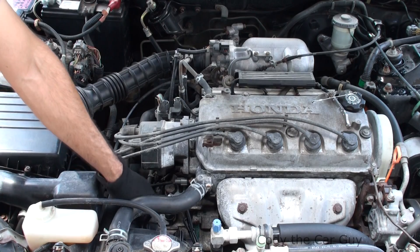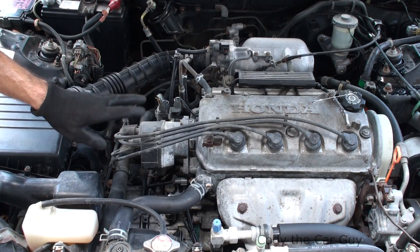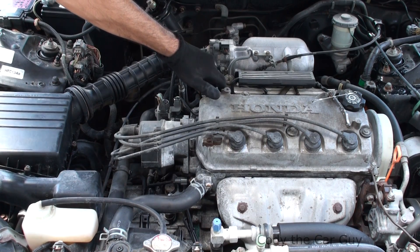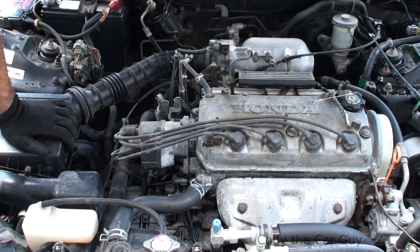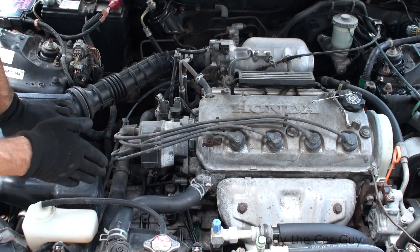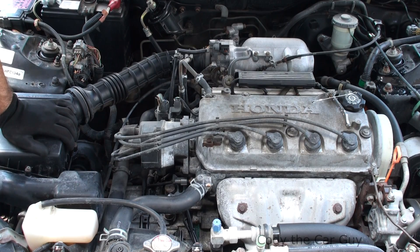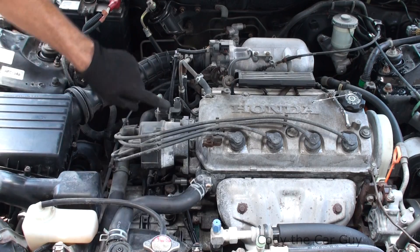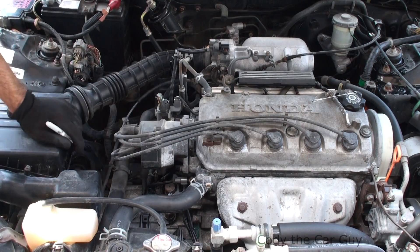A lot of times when you get an oil leak coming down on the front, if it's not coming from where the valve cover is, you've got two other things that leak oil pretty good. You've got an O-ring on your distributor, and then you have your VTEC solenoid on the back side. This one had a lot coming around on the front of the engine, so I pressure washed it yesterday, and on the bottom side of the distributor it's actually got a wet spot for the oil. So you've got three 12mm bolts — we're going to remove those, take a black magic marker, and mark where your distributor was sitting in there.